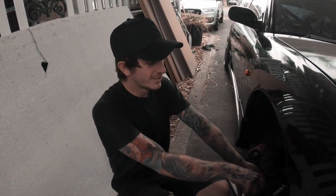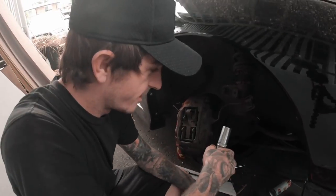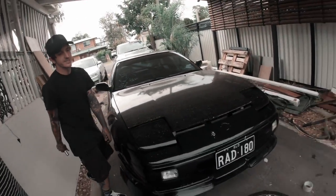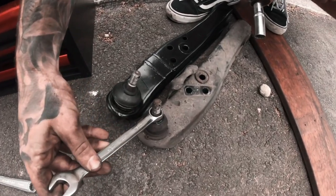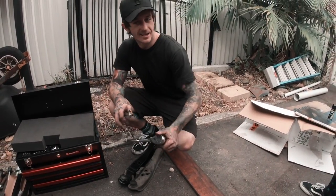Welcome back to the vlog — down here fixing up the 180, Chang's on the ground. I always stop filming when things go wrong because I get frustrated, but Brad's here to help fix the situation. The ball joints I got pressed into the new LCAs — the taper on the bottom isn't going through the knuckle, it's actually a bit bigger as you can see on the pair over there. We got so close but so far. We'll have to take them out, go back to the shop. That's the wrong ball joint from yesterday — annoying because it's Saturday and everywhere's shut. Gotta wait till Monday.